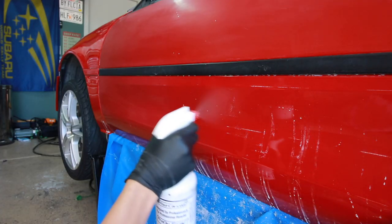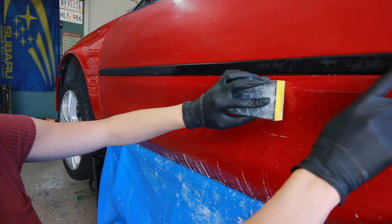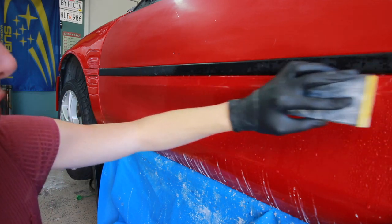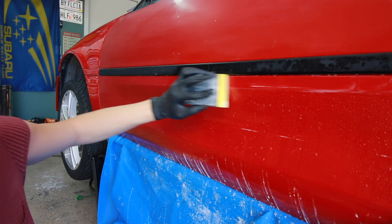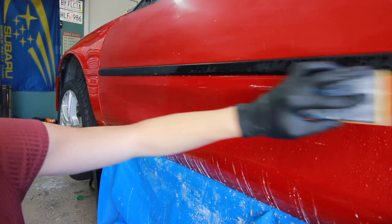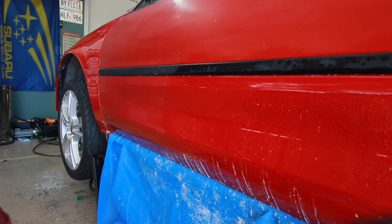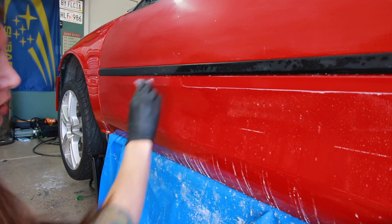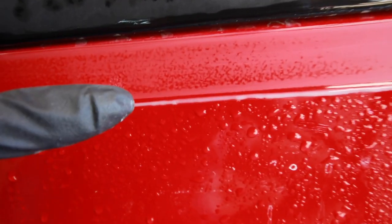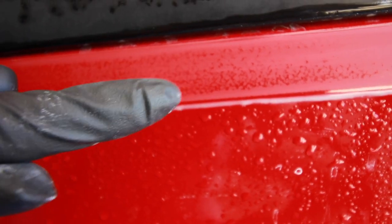Just get the area nice and wet, like so. Normally you would want to mask off areas like this black trim, but because I need to refinish the black trim on this car anyway — it's all messed up from when they originally painted it, or maybe just because it's almost 30 years old — it's going to have to get refinished regardless. So I'm just sanding this area right here. You can see the white residue, which is actually clear coat. Then I squeegee it — see how there's dark red visible with light pink around the edges? That dark red is the low spots in the clear coat, the orange peel — it kind of looks like the peel of an orange.